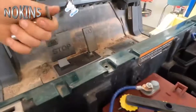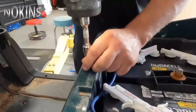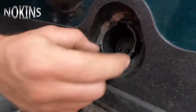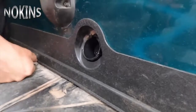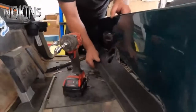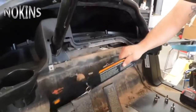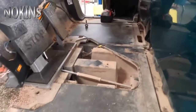Next, we're going to loosen these up and take this rear body screw out completely on the passenger side. We've got three screws here — if there's a cap, take a small screwdriver and pop it out so this black piece comes loose. Now that we've taken our screws and body screws out, we're going to lift up on the body and pull this black piece out and set it to the side. Next, we'll remove our dash, and the last thing to do is pop this inspection cover. Now we're ready to install our wiring harness.